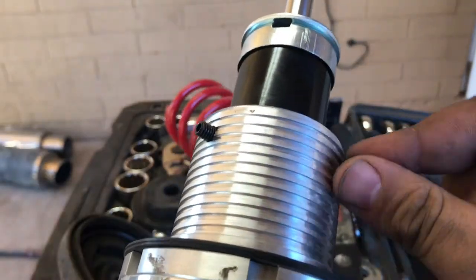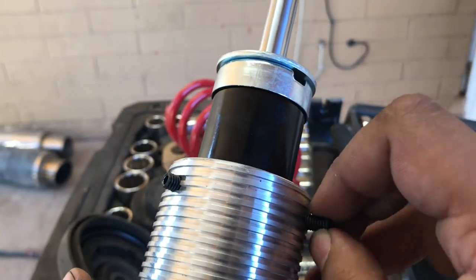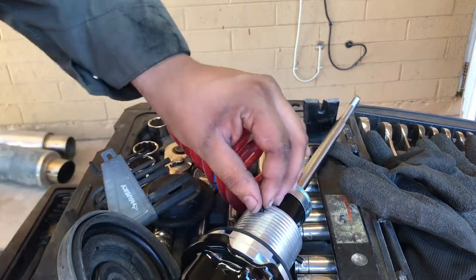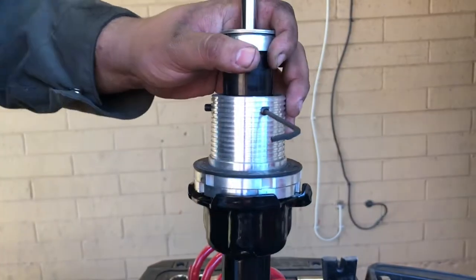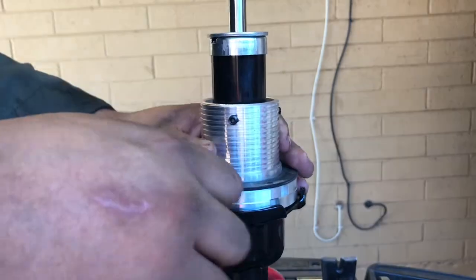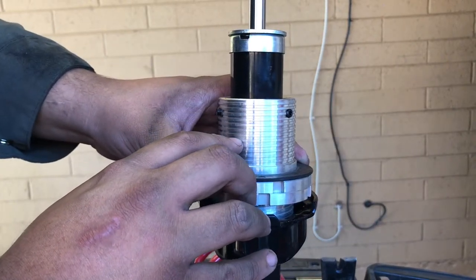Make sure that you install all the screws equally — you don't want one super tight and one super loose. You want to make sure that your sleeve is staying centered and it's not lopsided, because this is what's gonna be holding your spring. Some of these coil sleeves come with numbers; mine didn't. After tightening this up, I start counting the threads to track how far it's tightened. I go off of the tenth one — I count down and put it on number ten; that's how I installed my other side as well.